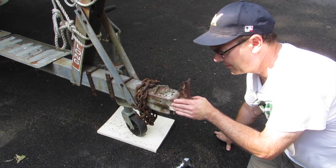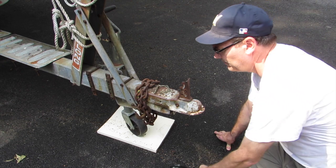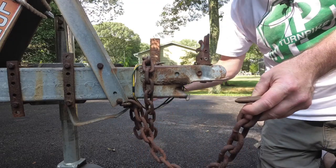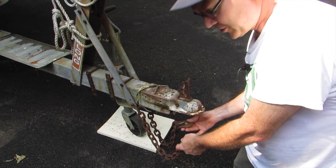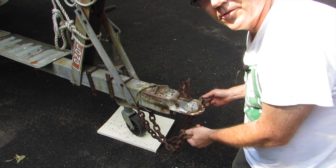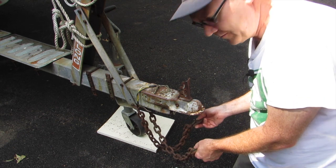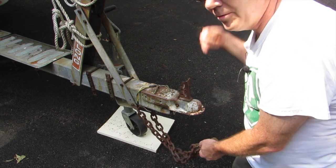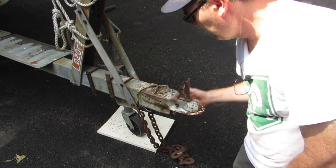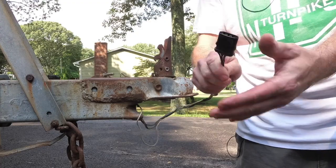Let's talk about how it connects to the back of your vehicle. You have your connection right here secured, and then you have these safety chains. The safety chains are very, very important — they latch onto the back of your vehicle. The rule of thumb is to cross the safety chains. If this for any reason breaks or comes undone, these should keep your trailer from completely going anywhere — it will just drop down and drag, held along with the chains. This wiring harness right here connects to your trailer lights.